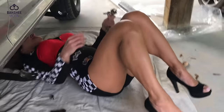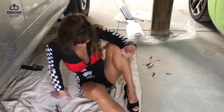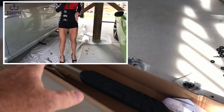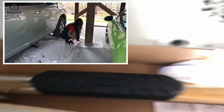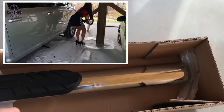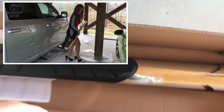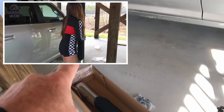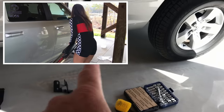My helper has left me, but I've gone through the parts. Here's an important thing: notice there's less area between the step pad in the front of this side step than in the rear. That differentiates front from rear — the short end of the chrome part goes to the front and the long end goes to the rear.